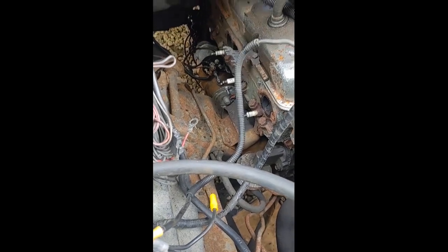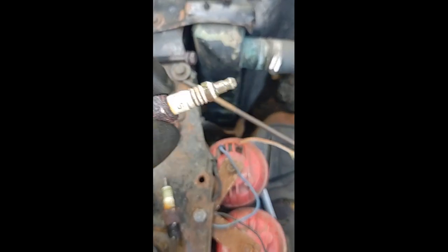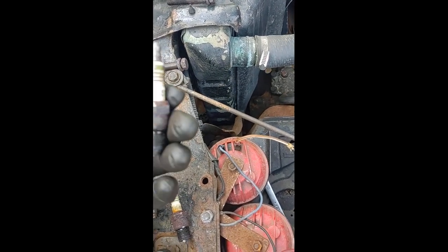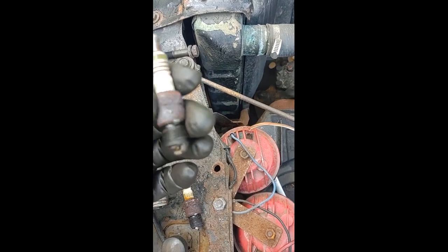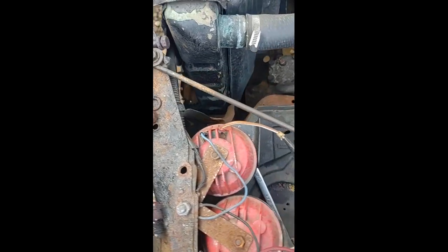As far as starting it — I jumped the starter and the car cranks over, so it's not the starter. It's the wiring, the ignition switch, or something like that. Also, one of your spark plugs broke off on this side, and you've got two different brands on each side. The ones in here are ancient — they haven't been this short in 30 years. These are probably the original plugs from the '70s or early '80s, with so much rust on them.